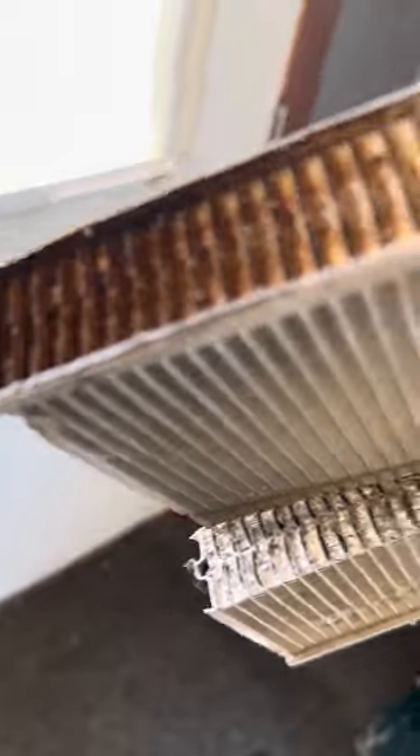Does that make sense? I have people ask me all the time, why is my heater core plugged up? It doesn't make sense — I flushed it out, it flows great through there. Water goes through it, I blew it out, it should be just fine. Well, it's because this core is plugged up on half and not the other half. Hope that makes a lot of sense. See you guys under the hood.